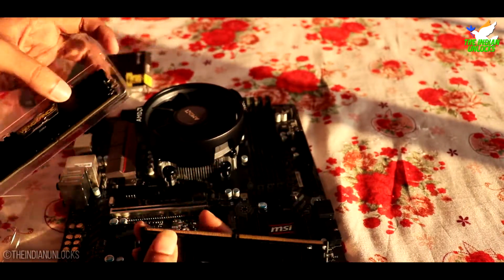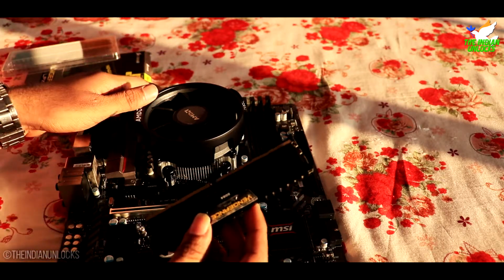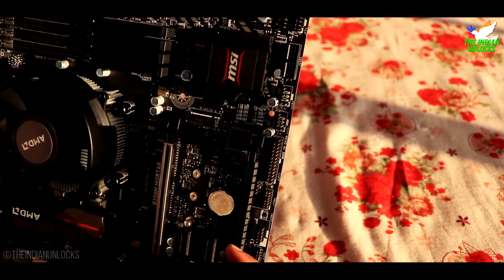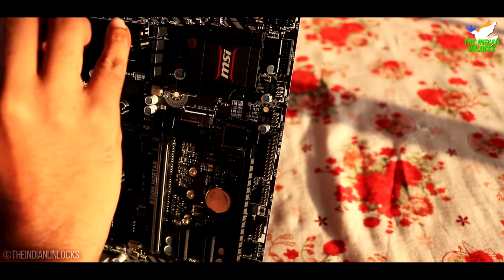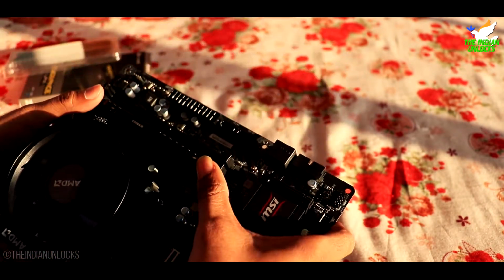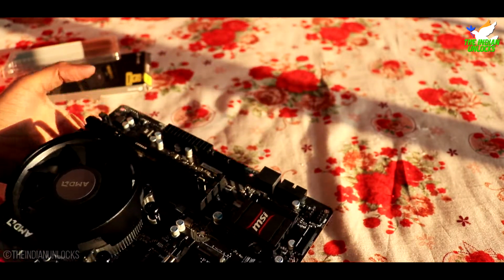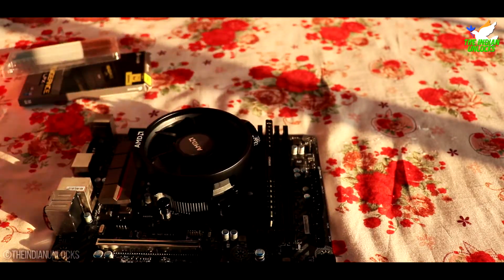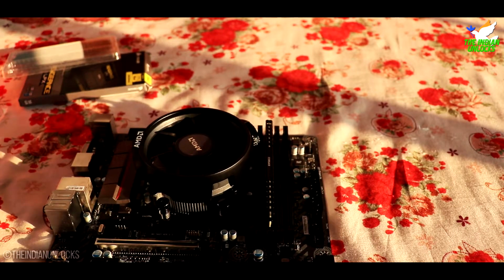As far as the memory frequency for Ryzen 3 is concerned, I did not find much of an increase in performance while overclocking and using high speed memory. 2400 MHz is quite good for a Ryzen 3 system, that too on a budget system. Although I would recommend you go for a 4x2 or 8x2 configuration, because you will get a dual channel configuration and that might help you in some games as well. So if that is possible, do get a 4x2 or 8x2 kit.